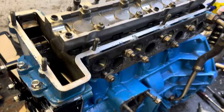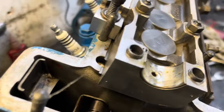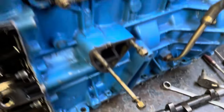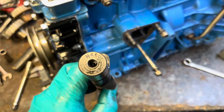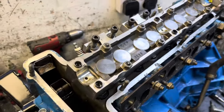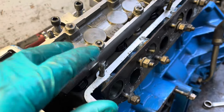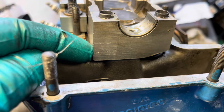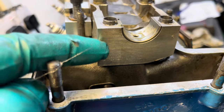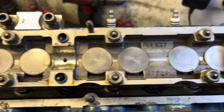Good start to Monday morning. Just coming to put the cam carrier back together - I've just checked the shim clearances and made a couple of adjustments. Now back in the day this was called a Hartwell 410 cam - H410 - so that was 410 thou of lift. Most imps only ran 360 thou of lift at the time, so this was the bee's knees. What they did, because they were still running chill cast followers, was if you look, you can see how the head has been machined and the carrier is deeper - it's called the deep carrier. The idea was that when the bucket was on full lift it was still supported by the carrier, and the head was machined to take the carrier. Beautiful bit of engineering, absolutely lovely.